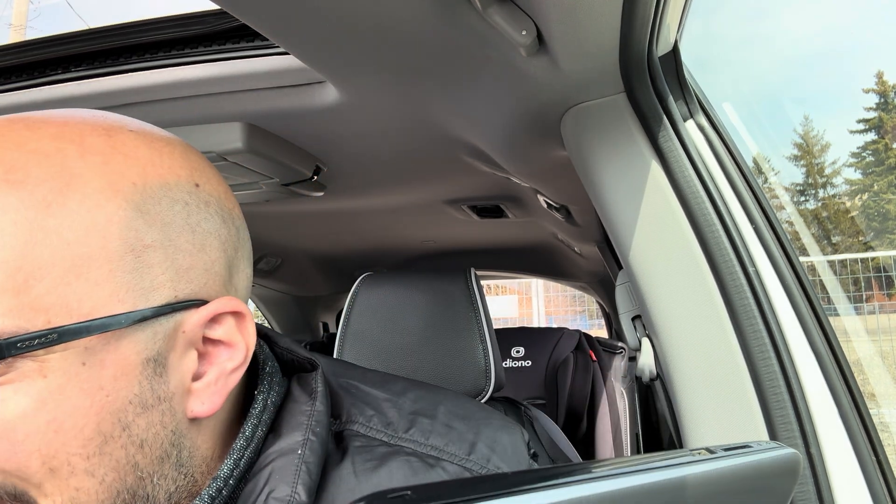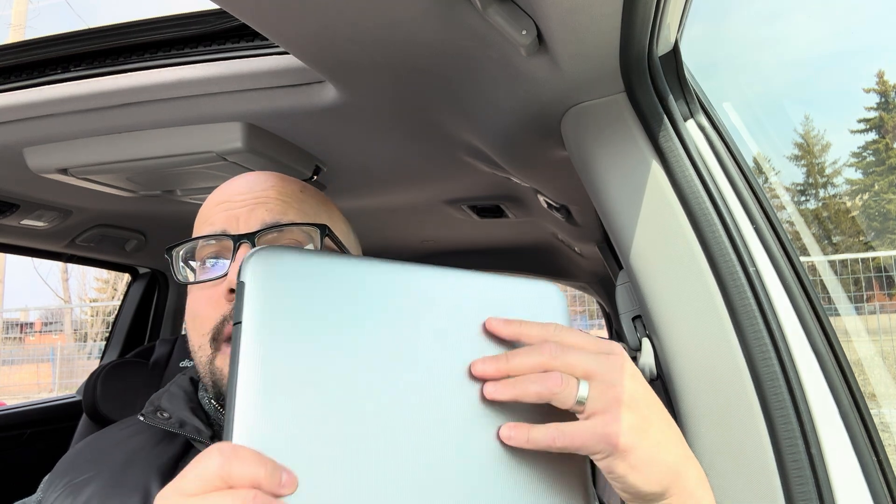Number eight: try using an external monitor. You might think it's your laptop, but in reality it might be the display. Maybe the laptop is powering on but the backlight isn't turning on and the display isn't working — so you just don't realize it's on. Connect an external monitor and see if that makes any difference, even just for troubleshooting purposes.